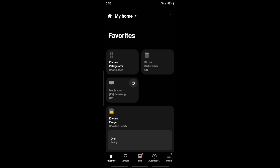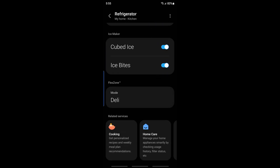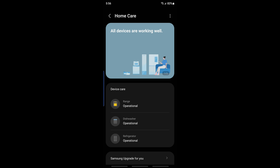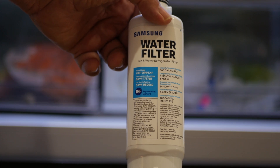You go into your SmartThings app, go to the kitchen refrigerator, pull that down to the bottom, and select Home Care. You may need to download this to reset the filter minder. On the next page it shows all your equipment — your range, your dishwasher, whatever Samsung devices you have — and you select refrigerator. After selecting refrigerator, you can see that the water filter is good, replace filter every six months, and there is a filter reset option. That is where you go to reset your filter if holding the button down doesn't work.